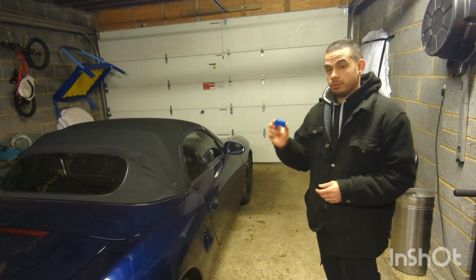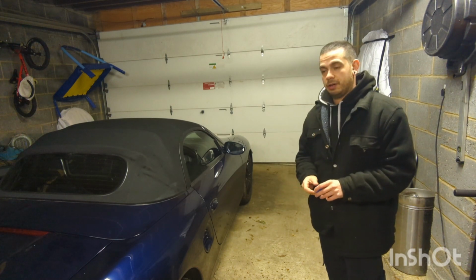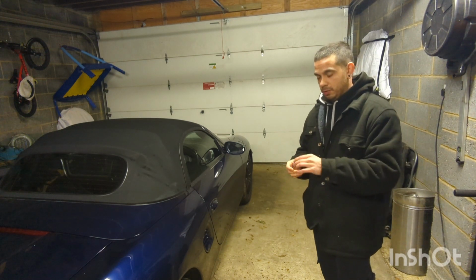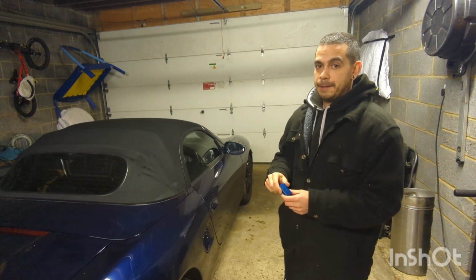For a little bit of general good housekeeping, if you like, with these cars, I would highly recommend getting an OBD2 scanner. I have a fancy one that has got specific software for being able to read this car. It's not super fancy, so I can't do airbag stuff, but that cost me about 120 quid. Everything that it can do, this Bluetooth dongle, which cost me about 3 quid, and an app on my phone called Torque Pro can do as well.